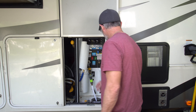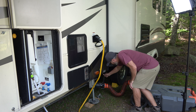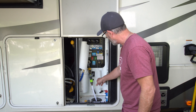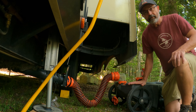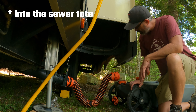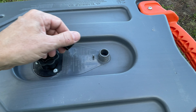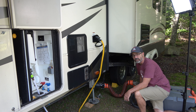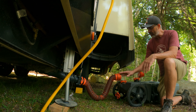All I have to do is come over here to our gray tank, pull up my valve that goes to the gray tank, and make sure that this is all connected ahead of time. I am going to pull my gray tank right now. You can see that the water is coming from my gray tank and into the tote. I have to release my air vent to let the water continue to go in. This is where it is really helpful to use this method, because I don't really have to watch the water going into the tank — overfilling is where it makes a mess.